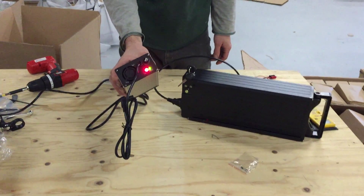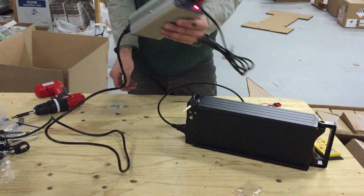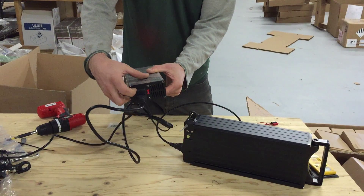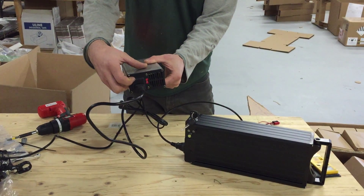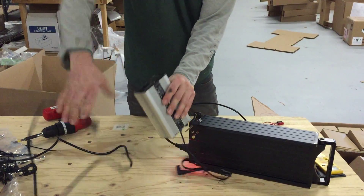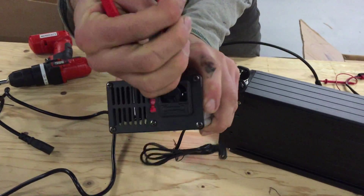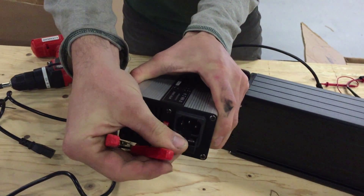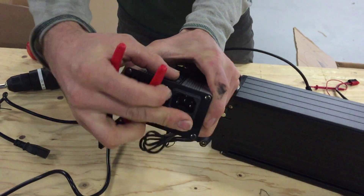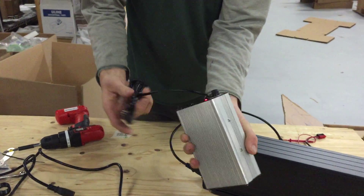You can see right now we have both lights on the charger, and it's just plugged into the wall. If you get both lights on when it's just plugged into the wall, then you know that the fuse on the AC side is good. You see there's a fuse and a slide-out tray here. You can put a tool in there and flip that out. You could test that fuse with a multimeter, but we don't need to because the charger will. So we put that back in.